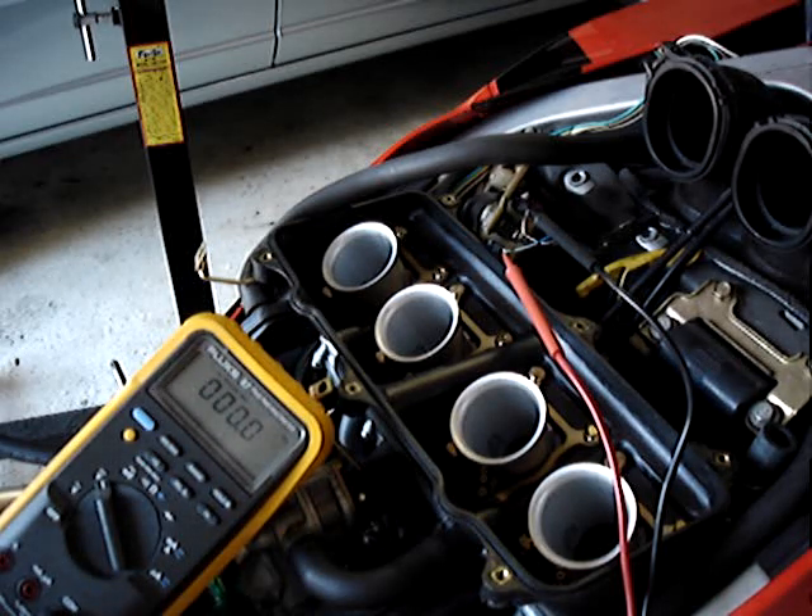Start the bike. You can see we're picking up peak voltages upwards of 90, 102 volts. So 100 volt peak voltage is the spec. Here you can see we're well within the expected range.